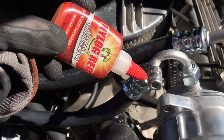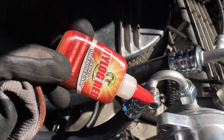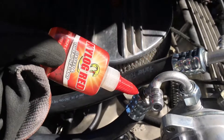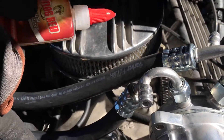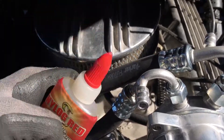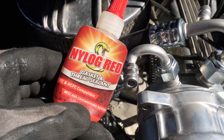By applying a little spark plug blue grease, which is a dielectric grease, or something like this — Nylog — you take care of it, you have good sealing under vacuum and good sealing under pressure, and your O-rings will last well in your fittings. So that's it: Nylog or spark plug blue grease.